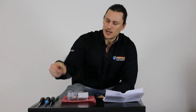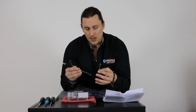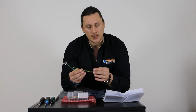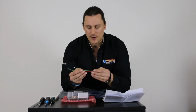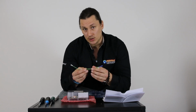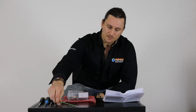You will also find that it comes with a couple of wires inside of it, which are thermocouple grounding wires. The instructions will give you indication of what we need to do with these, but it is important that the thermocouple that's in your QuadraFire is grounded properly. In the event that you have an earlier unit that does not have the ground in place for the thermocouple, they do include these with the control board, so we can make sure that we get that 100%.